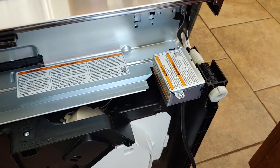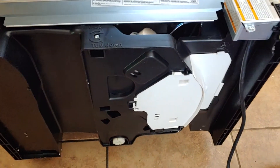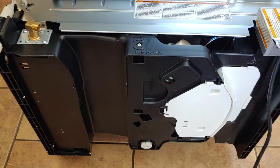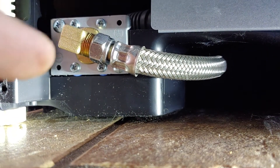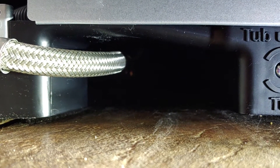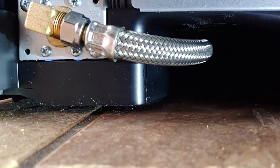While we're at this same vantage point, notice the leveler feet on this unit. There's one on the right front, one on the left front, and a center back. A tripod is always easier to level and will always sit in contact with the floor. You'll do the final leveling of the unit once it's in the opening. Now it's time to tighten up this water connection — the main water line is coming through the cavity provided under the dishwasher in this model, and on the right you can see the electrical box with the cavity where the wire runs back. Make sure you're not setting the dishwasher on top of any of these lines.